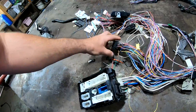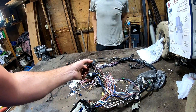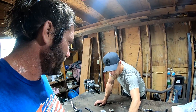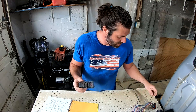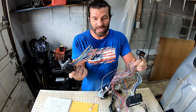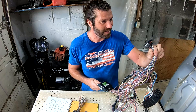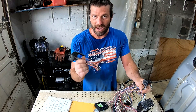I think we're gonna have to start right here with this. This little plug right here took such a hard hit — we're gonna have to swap this out for another one that I got from the junkyard. I hate to do it, but that's probably where we're gonna have to start. We don't have to de-pin it — I'm just gonna cut them off and solder them. First thing we're gonna do is swap this junkyard connector into this harness here. This came out of my Tundra, but it's broke because it got hit. There's quite a few wires here, but some of them actually run through this harness to the 4x4 computer or other stuff. We're gonna figure out which wires run directly to the 4x4 computer and solder those in first before we move into the truck. Let's cut to the time lapse.